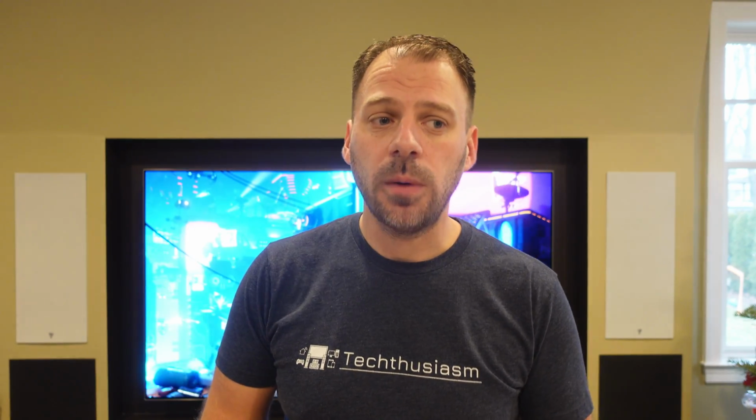One of the big challenges you get into with taking 1 source and trying to connect it to 2 zones is you may have very different video capabilities between your zones, and I have that as well. This LG G2 behind me can do a whole lot more for gaming than my JVC NX7 projector in the basement can. We have ALLM, we have VRR, we have HDMI 2.1 and 4K 120 capability on the TV. We have none of that on the projector in the basement. It's capping out at 4K 60, 18 gigabit HDMI bandwidth. So in cases like that, it's nice to be able to have 1 common HDMI information signal going to basically both display devices and setting things up with kind of 1 common set of settings.